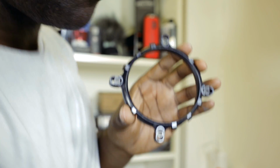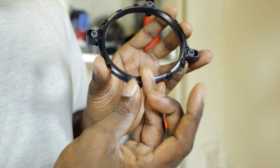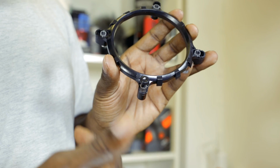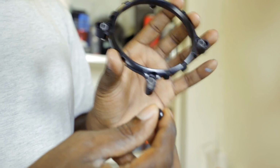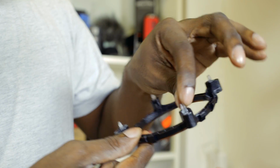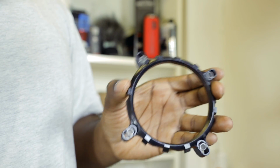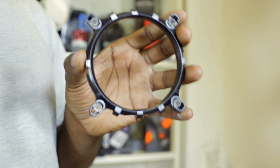So what will happen now is that these pop rivets would actually just pop into the top and seal the deal on your CPU air cooler, and this is the bracket, and this goes straight into the motherboard. So it's simple as that. So that's what I'm going to do. Obviously these will close, these will be open, and as soon as I put these pins in, it will close the bottom, so the bracket will be secure onto the motherboard.